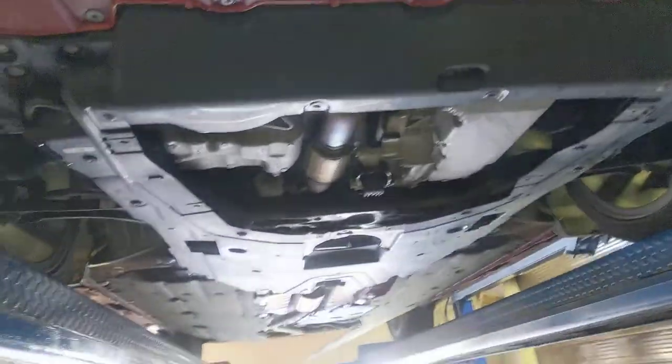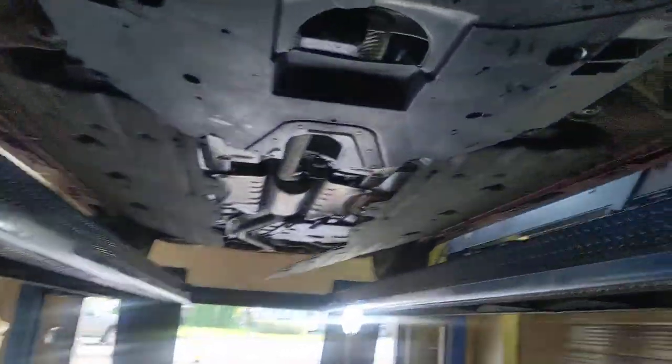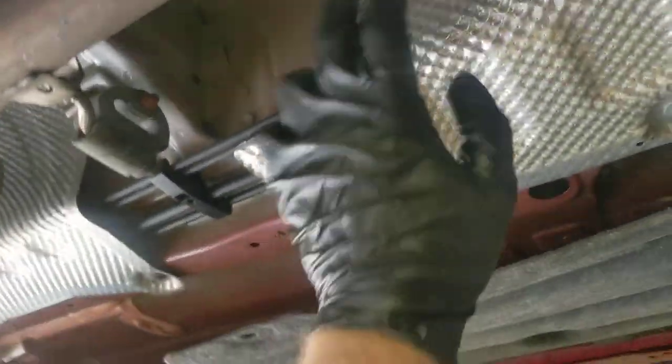Because it's fabric — it's compressed fabric — it gets soaked with this corrosive road salt slurry and then it eats away at the metal. I said talk to your mechanic and ask him to take them off if that's what you want, it's your car. You've all seen it if you follow my channel: the tin heat shields will go first, they'll start to corrode first because it's just cheap Chinese tin, and then the rest of it will go.